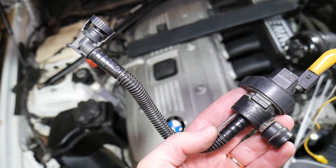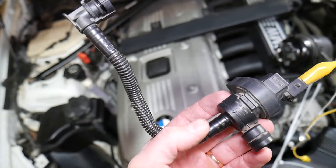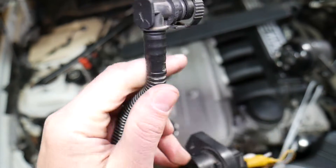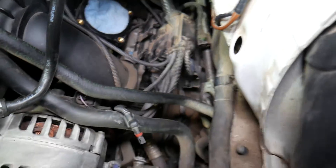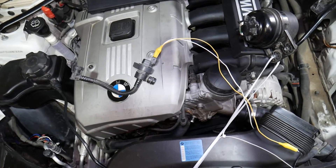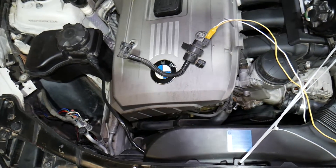Very low pressure air — two to three pounds — is enough to make sure it's working correctly. Also check the O-rings: there's one O-ring on the connector and one more O-ring on the side coming from the fuel tank. Check those and that should tell you if your purge control valve is good or bad. Thank you for watching — please subscribe to the channel for more videos and see you guys next time.